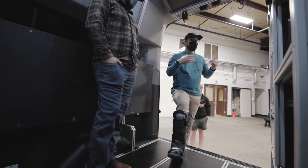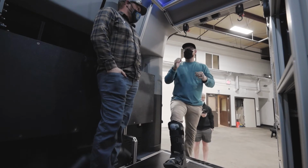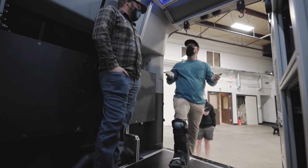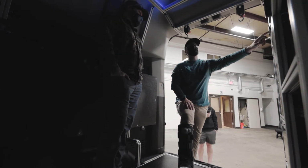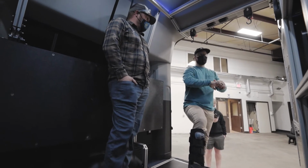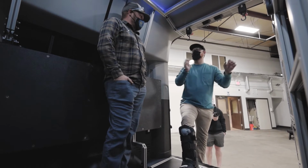But let's say a scenario where your vehicle just wouldn't start. Like it's been sitting inside, or you were gone for a while and the vehicle battery is just too low. Well, you come in your van, you hit some of these switches, this system still has power. We can press it to on, overriding it, and now directly connecting the front to the back. And we're jump starting that vehicle from this system.